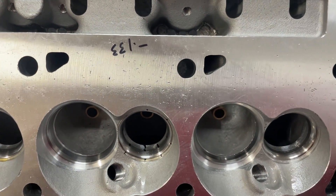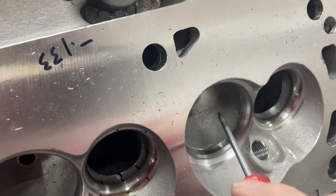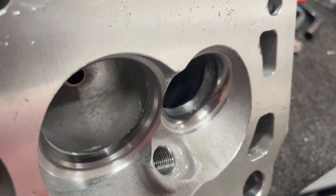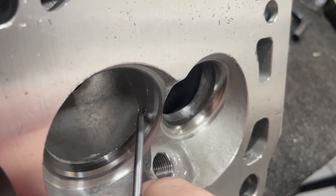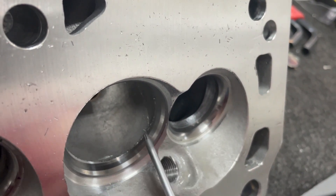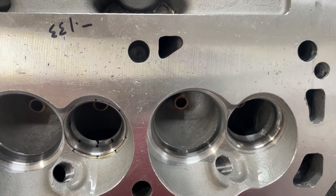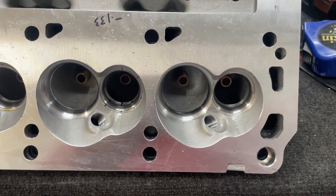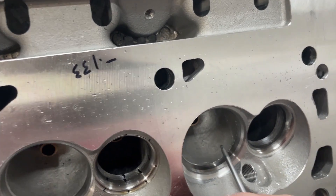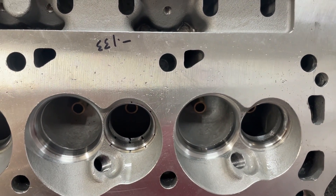We still have other issues — remember, this is why I'm not a superman. There are things grinding can't fix because you can't take away what's not there. The valve job is in and right through here there's no metal, so this is going to be horrible. I'm going to have to make my throat a different shape than I usually do just to compensate, and probably bigger than I usually would for this application. But it's a case of balancing evils — a throat that's too big is a bad idea, but that metal situation seems like it's going to be worse.